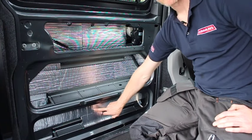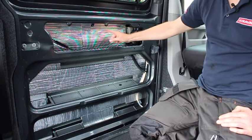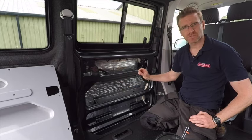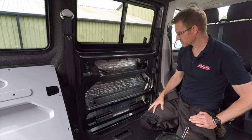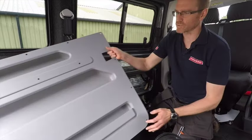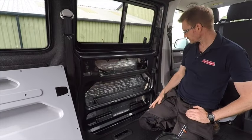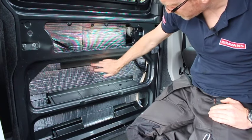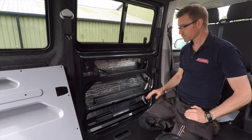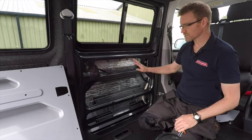This material we've stuck on here is sound deadening mat. It's very thin so you can put a layer of that into the back of each cavity. And this one on the front here in the top and middle cavity is our 7mm insulation foam — it's a self-adhesive insulation. It'll fit in there, but don't put it in the bottom or you physically won't be able to fit these pockets into your door. Best not to insulate on these raised bits top and bottom here because space is at a premium.